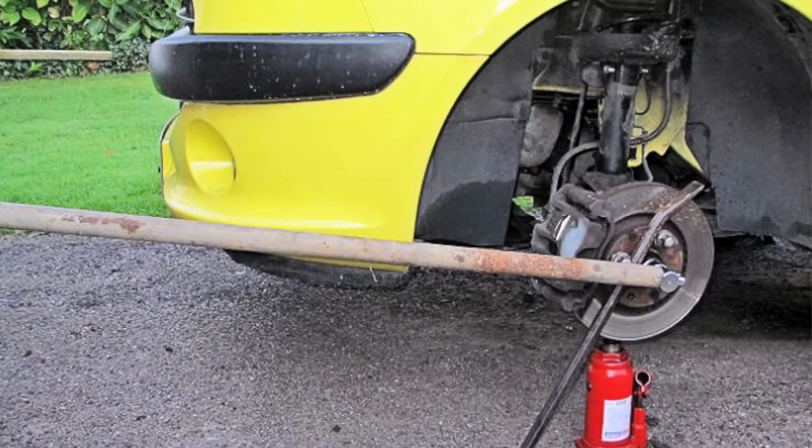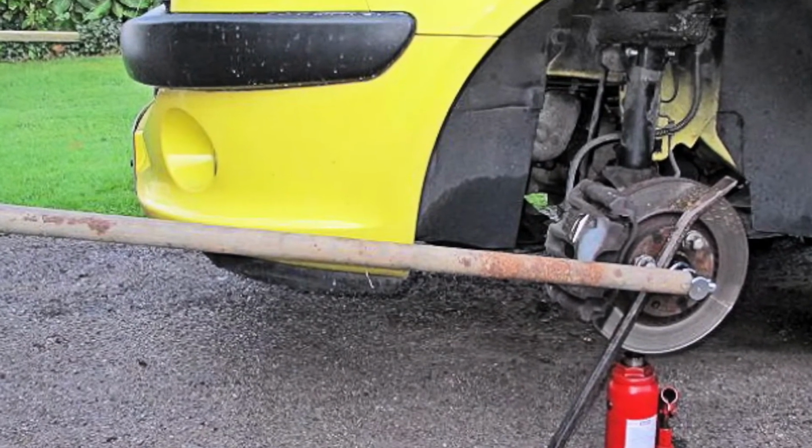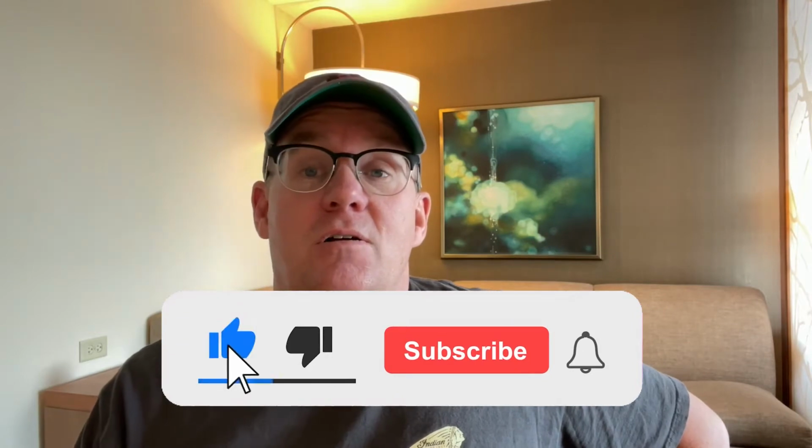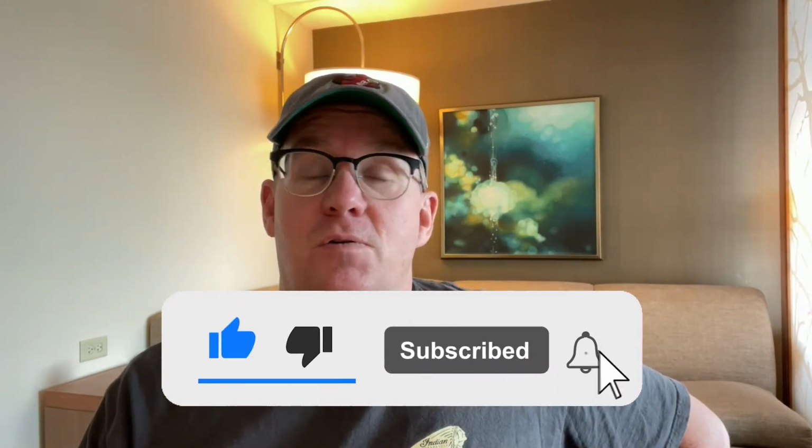Now I would not encourage them as a first-time user because they can be unstable if you're not careful, or if you put them in the wrong spot, they can slip off the item that you're trying to lift up. So if you don't have experience jacking, I would not encourage you to use that as a starter jack per se. Now, if anybody more experienced out there wants to tell me I'm wrong, leave it in the comments below. But I'm trying to encourage safety here, and I would not encourage that as a first-time user.